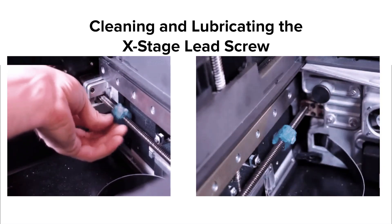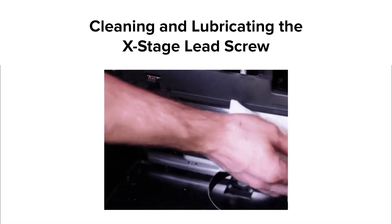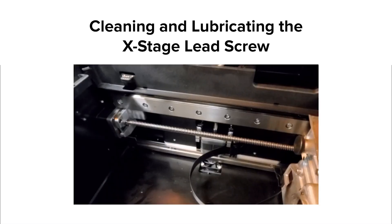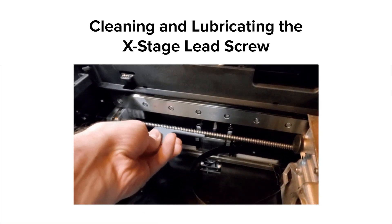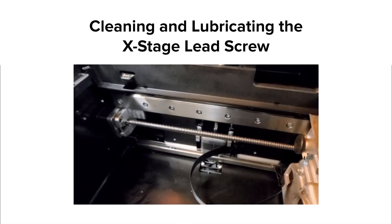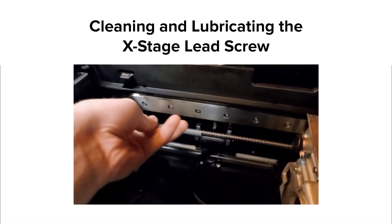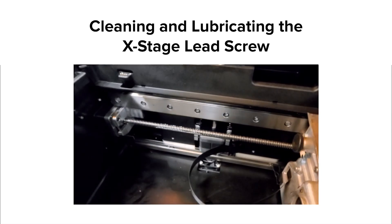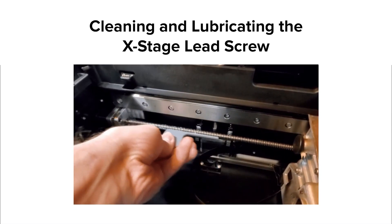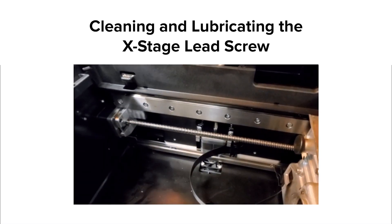The cleaning tool can be cleaned and reused. Repeat the process of wiping debris from the lead screw with a low-fiber paper towel or microfiber cloth. Now that the screw has been cleaned, take the housing off the lubricant applicator to expose the lubricant, then smear it onto the lead screw. Once the screw is greased, close the cover and power on the printer. The LPU will make its pre-check movement from left to right, which will disperse the lubricant evenly on the screw. While this procedure is typically done only as needed, it can be performed once every 12 months as part of a regular maintenance schedule.